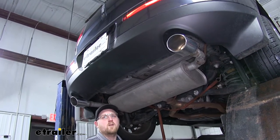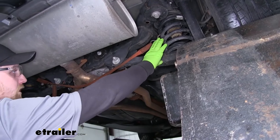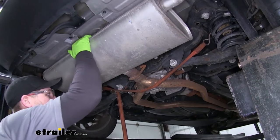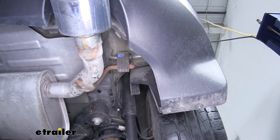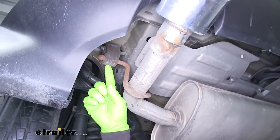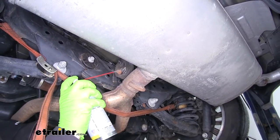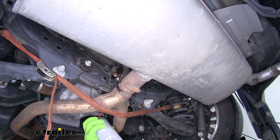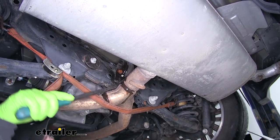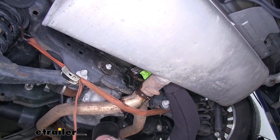To begin our install, we're going to need to lower the exhaust. I went ahead and did this already, but it's a good idea to get a strap and run it from one side of the vehicle to the other so that when we lower the exhaust, we can do it in a more controlled manner. We're going to need to remove three rubber isolator hangers — one here, one here, and then this one right here in the center. We're just going to use some lubricant to spray them down to make them a little easier to get off, then use a pry bar to pop them off. We're going to use that same procedure to remove the other two.